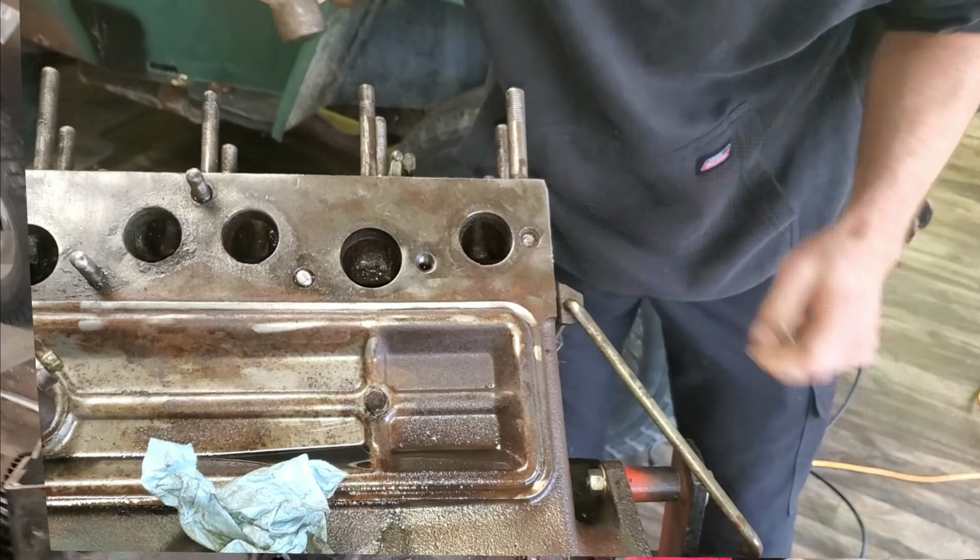Alright, so all we did, like I said, is we did the initial pilot hole, basically went a little bit bigger, and then we just went ever so slightly larger with the next step up. I don't remember what the bit size was, but this is our reverse thread easy out, whatever is supposed to pull this thing out that Kyle had nicely lined up for me there. I was going to get it started and I was going to have you turn it while I keep it straight.